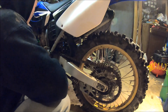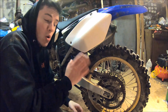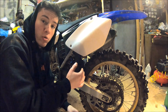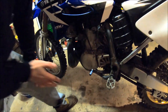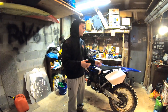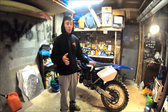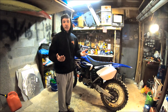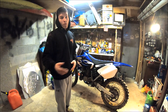Before you ever start up the bike, tell whoever owns it that you want to do a cold start. Before you start it, make sure the engine is actually cold. What sellers will do is start up the bike beforehand — any problem it has will be masked if it's already warmed up. If they're having trouble getting it to start, a warmed-up bike is easier to start, so they'll do that to basically screw you over and sell the bike.